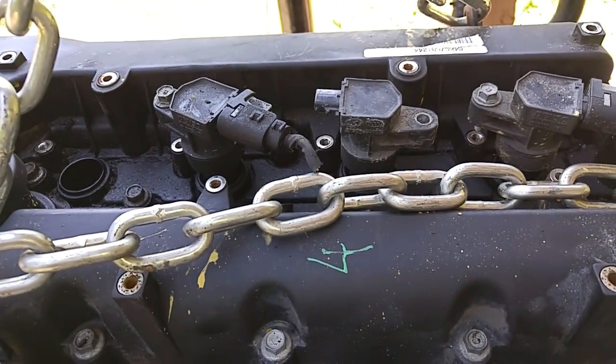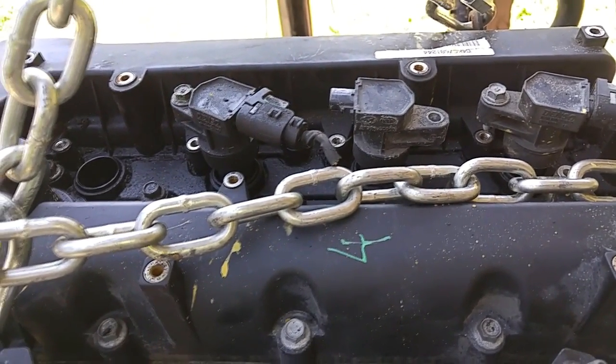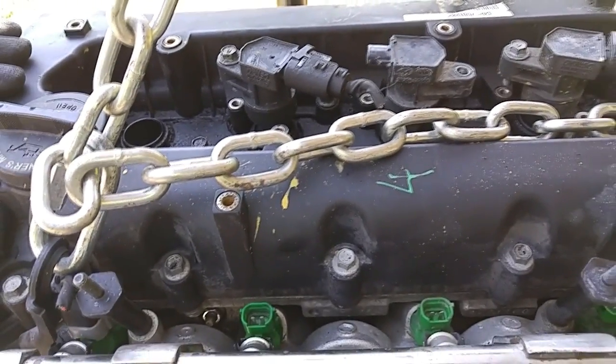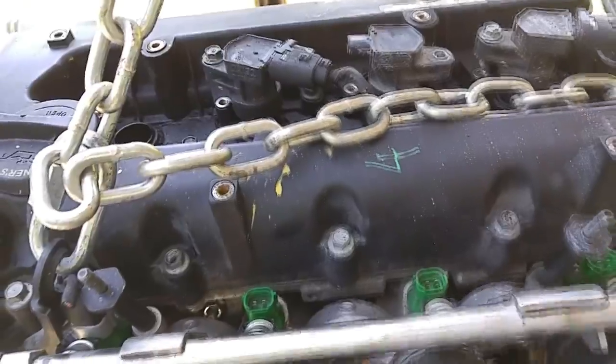I ignored the black plug in cylinder number three, which turned out to be a mistake, making this my second engine transplant on this car. The first transplant was burning excessive amounts of oil and I concluded that a piston oil ring was shot. So no matter what I did, the oil burning wouldn't stop and the spark plug always came out black.